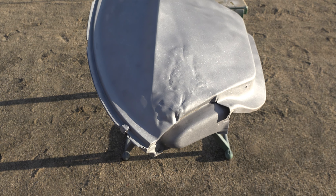And now with the backside of the fenders totally complete, I can now focus on finishing up the front side. I begin to work on the front of the fenders by block sanding everything smooth. After a lot of sanding, I wiped the surface down and began applying glazing putty to some minor dings that were still present. While I was applying the glazing putty, I noticed a major defect that was not good. On the front of the fender, the inside was bent inward slightly, and after comparing this with the other side, I could tell this was not supposed to be there.